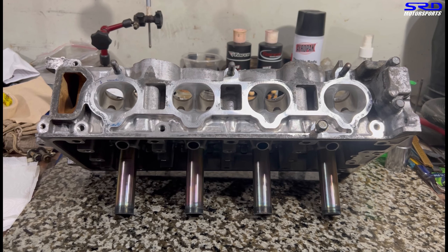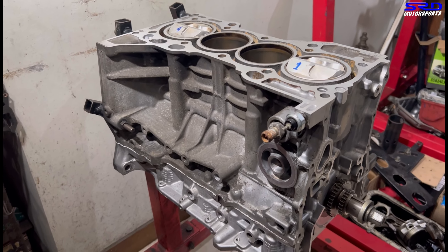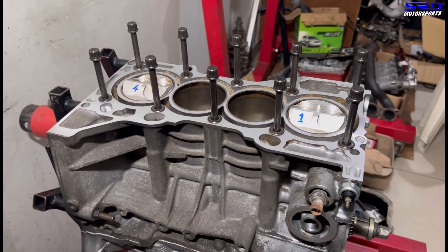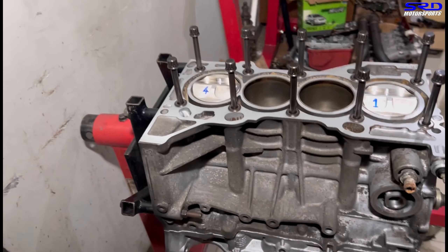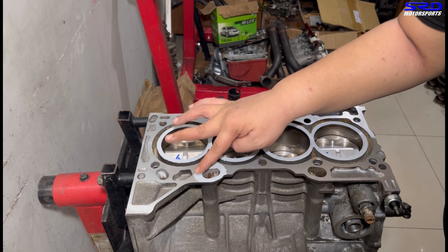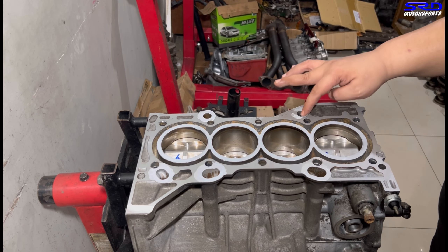Now let's go back to the block on the engine stand. The bottom end is fully complete and done, ready to be sealed up with the head. Now, this is optional, but we lubricate the head studs with ARP lube and hand-tighten it onto all the threads because the block is thoroughly cleaned with zero oil on the thread. This helps avoid mishaps and squeaky sounds when torquing. We pre-lube it, then remove it. We then apply a very, very thin coat of Honda Bond — 3-Bond in this case — on the oil drains. Just super thin; it doesn't have to be thick, and it's optional.